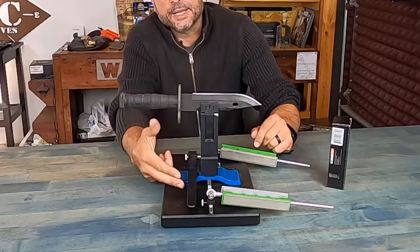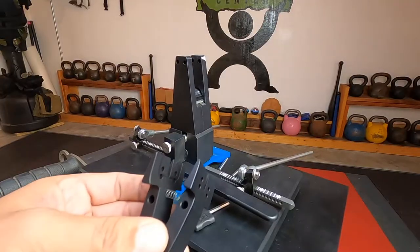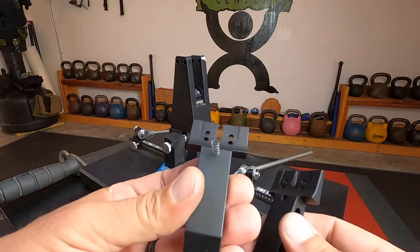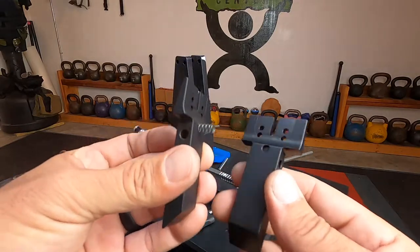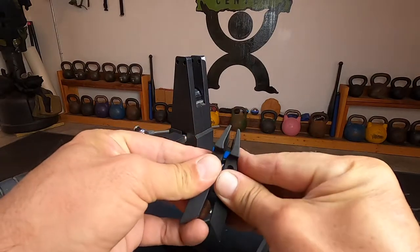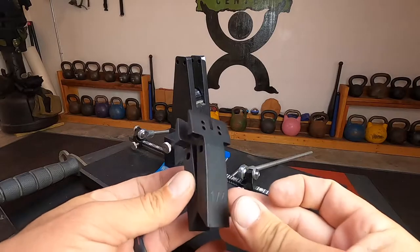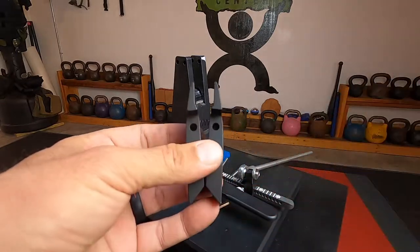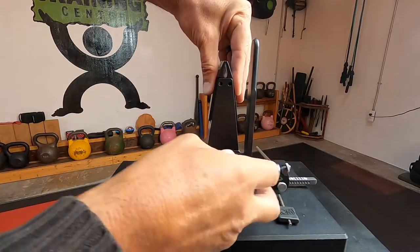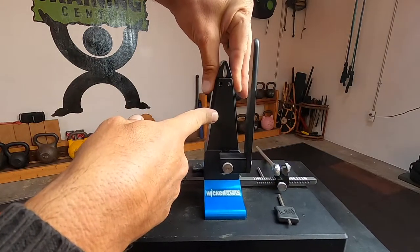Be sure that the lever is in a fully open position. The newer jaws will come with the spring basically separated, but you'll see that there are two grooves on the inside of the jaws. Just be sure to line up your spring in there and clip it in — you'll actually hear it clip on one side. Then I did the same exact thing with the other side, sandwiched them together and made sure I heard that little click so that the spring stays affixed to both sides of the jaw.